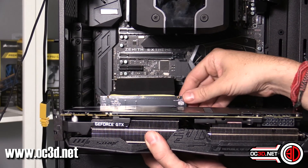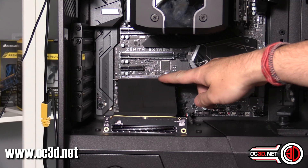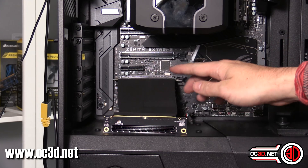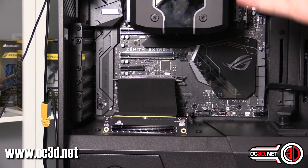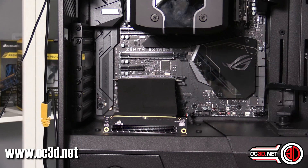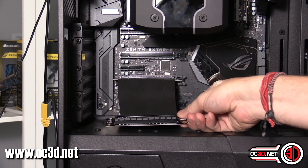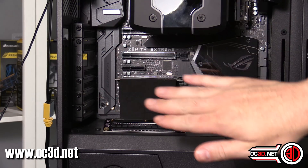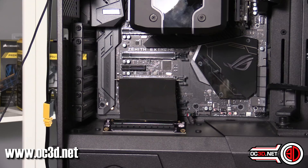With the riser cable, you do have to be very careful about not putting too tight a bend on anything, because if you put a 90-degree bend on it, you can break the traces, and that can be the end of your riser cable. If you've ever had riser cable issues, it's normally 9 out of 10 that you've broken the traces. So you have to go pretty careful with it — try and keep the bends all nice and S-shaped if you possibly can.